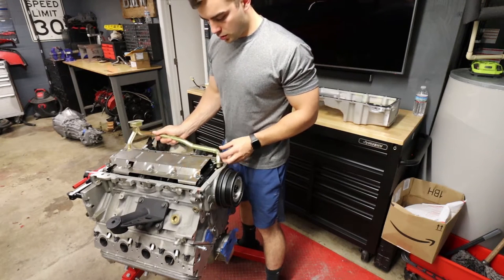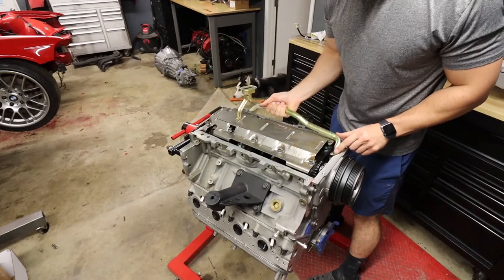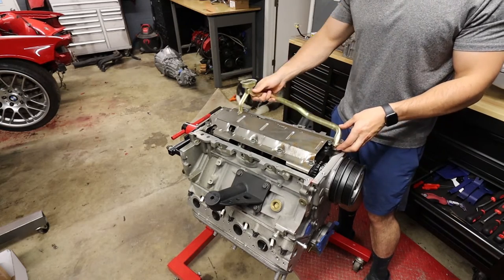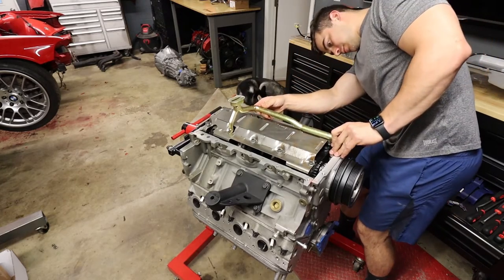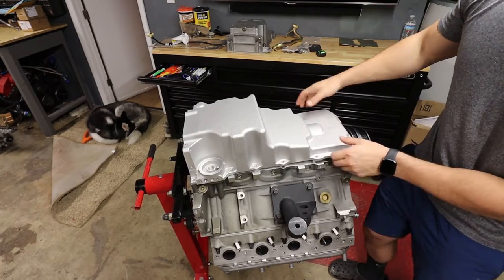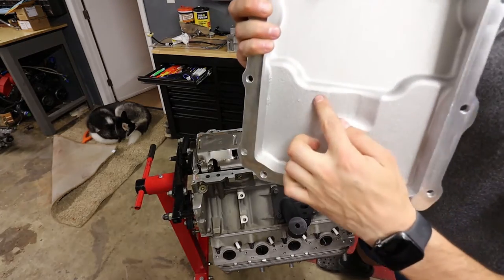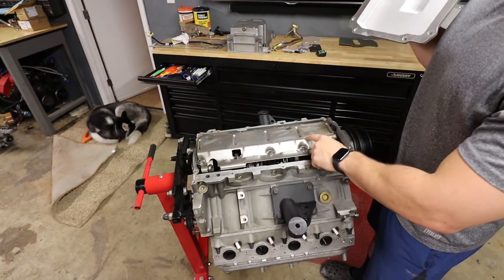will that work? Let me see. Okay, that might be what they're talking about. It's hitting right here. As I rotate this up and in, it can't seat the whole way because it's hitting right there. Now, as you can see, I have my pan on, but it's not sitting flush. Fits fine in the back. That's because the front hits due to the, actually you can see small mark there. That's one of the spots that it hits on here. So I have to measure 14 and a quarter inches up and cut that.